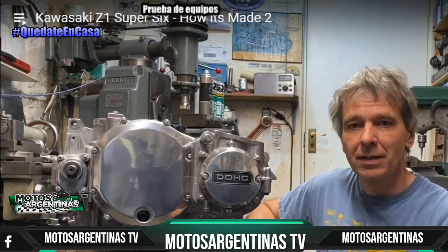With the second edge bent over, the cover slid nicely onto the engine engaged with the starter motor cover. A quick mark with a pen indicates where I have to cut with the hacksaw, so that the cover will miss the back of the engine casing. Then using my tin snips to cut out the little tiny segment. With the section cut out, the cover will now slide in place and engage down tight onto the crankcases.